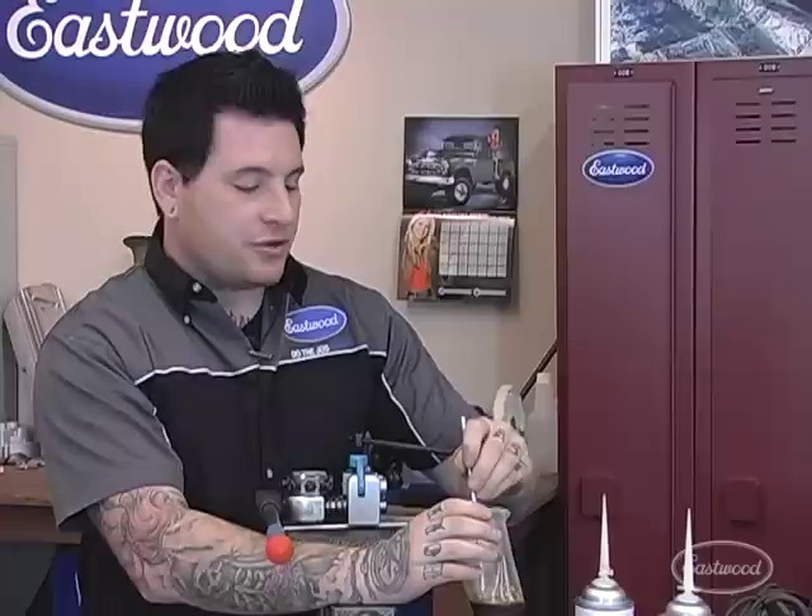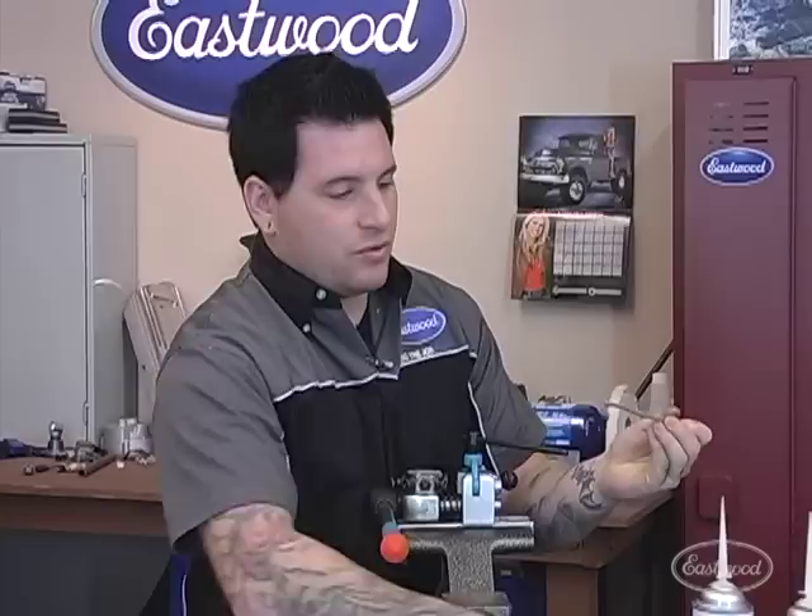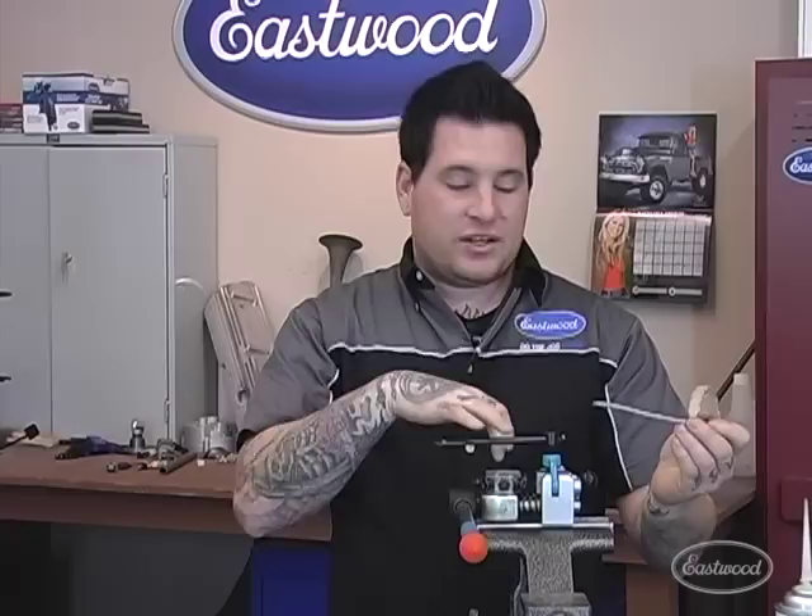After cleaning, take your aerosol injection lubricant and spray a little bit into a cup. Stick the end of the brake line into the lubricant to lube the end — this is going to help it flare a lot easier. This is especially important if you're doing stainless steel, which is even more difficult to flare. Even standard steel ones aren't easy, especially with the wing-nut style tools — you need all the help you can get.